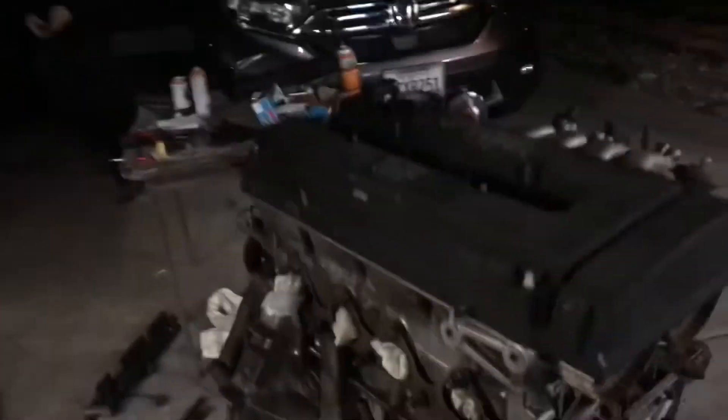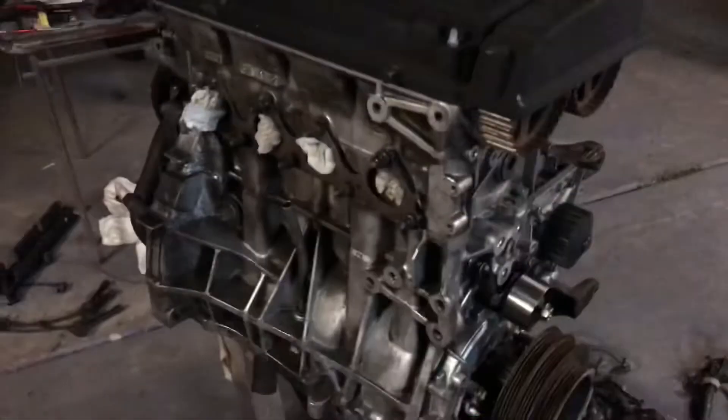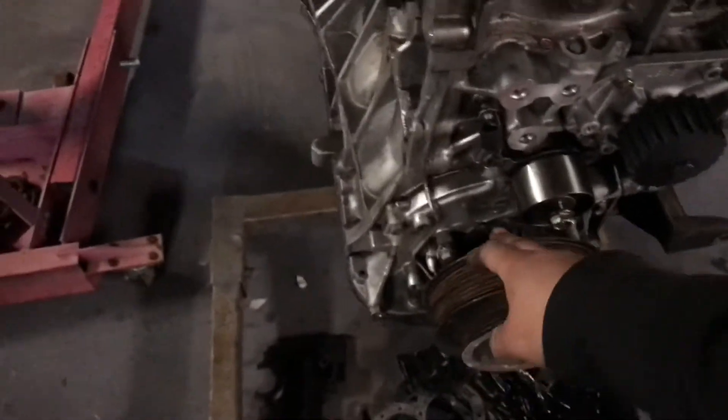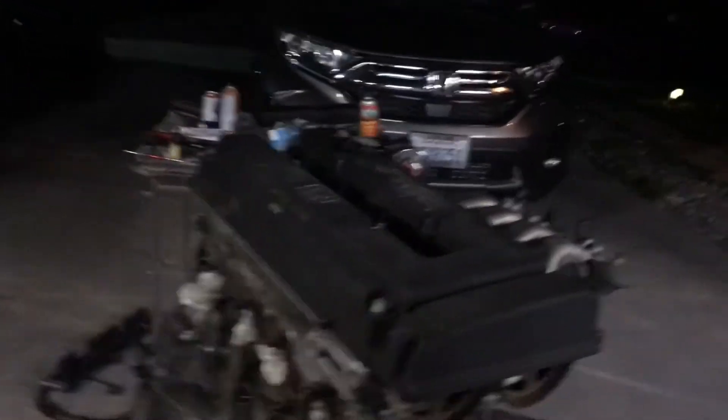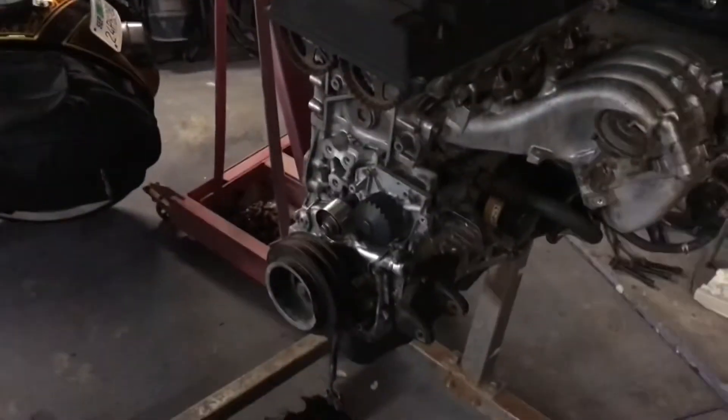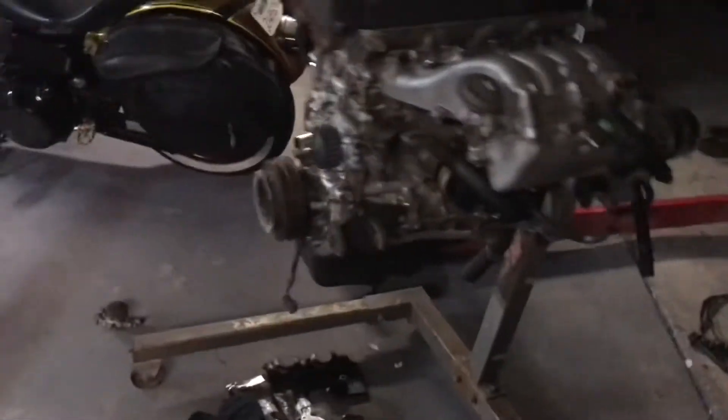So that's pretty much it on this video. I did the whole ARP studs and the whole valve train. The only thing left is he has to order a front main and rear main seal, the dizzy O-ring, and VTEC solenoid O-rings and gaskets — but I'm not going to show that on this video, I don't want to wait on everything to post. There are plenty of videos on the timing belt stuff. After that that's pretty much it — change those gaskets out and this thing's good to go. Make sure you guys like, subscribe, and comment. Hopefully I start doing my own motor soon and throw mine in my hatch — pretty much doing the same thing.